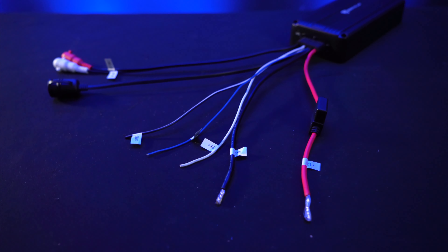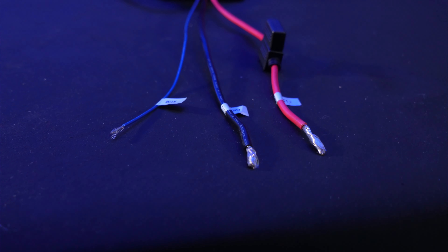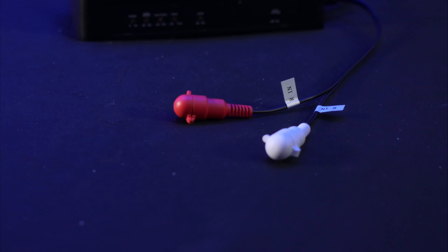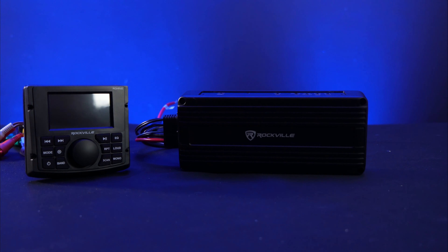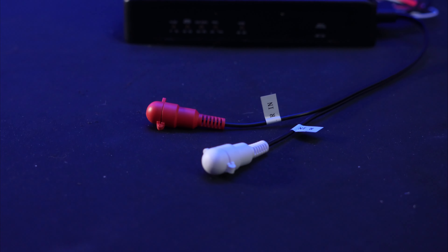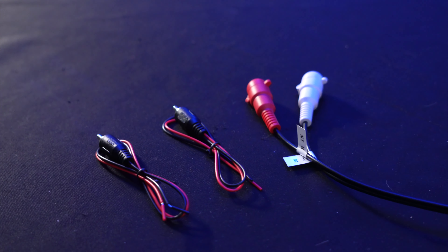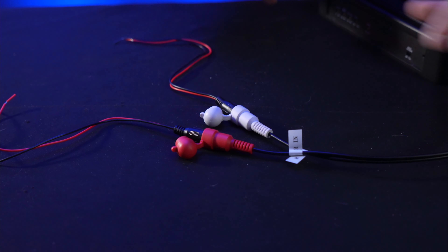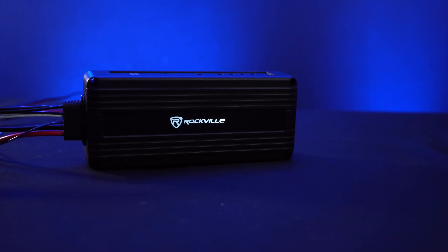When it comes to installing, the amp comes with a wiring harness that connects to the amplifier with all of the necessary wires to integrate into your setup. We've got our power, ground, and remote lines, the RCA inputs that you can feed from an external head unit or another amplifier. You can also splice directly into the speaker wire outputs from a factory head unit and use the provided high-level adapter speaker wire that plugs into the RCA inputs.